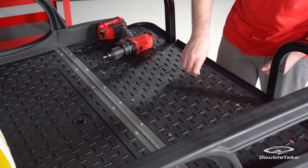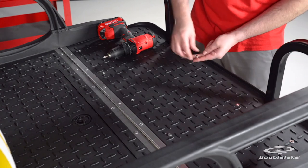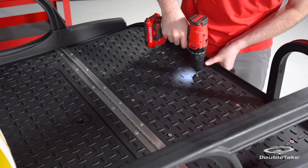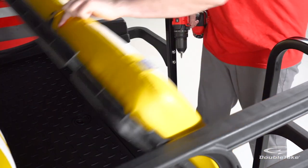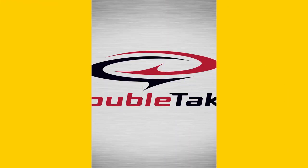Finally, remove the temporary stud and insert the last screw. Make sure the screw goes through the seat strap and tighten the screw. You have successfully installed the Max 6 Helix rear seat on a Club Car Precedent golf car. Now it's time to complete the long track top installation.